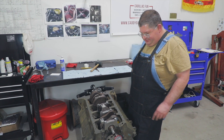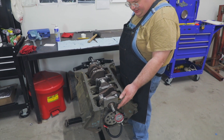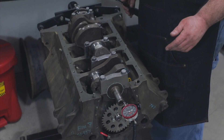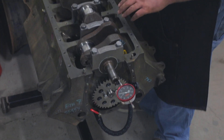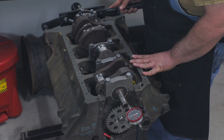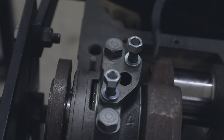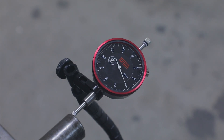One last check when installing the crank is the end play, measured with a dial indicator mounted on the block with the indicator on the end of the crankshaft. Using a small pry bar, we push the crank fore and aft in the block and measure how much end play there is. I've got it zeroed out. Applying pressure the other direction, we see about two and a half thousandths. That's a very small amount of play well within our tolerance — according to the spec we need between one and seven thousandths, so we are awesome.